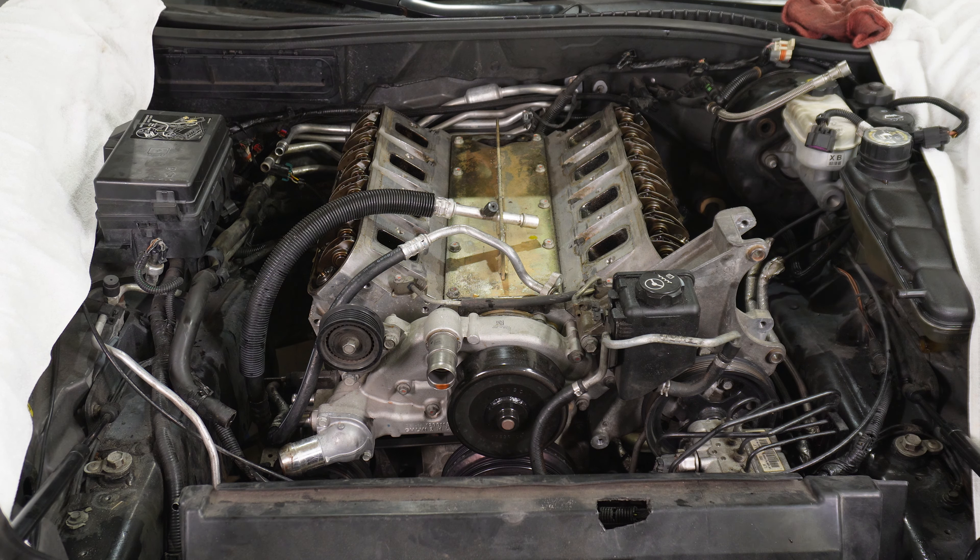This is the minimum mandatory. If you're just looking to get the engine out as fast as you can, you can leave all the accessories attached and just pull it out like that. There is plenty of room in front of the motor for it to slide forward the distance of the input shaft on the torque tube, and plenty of room for it to come up and out.